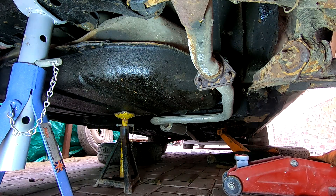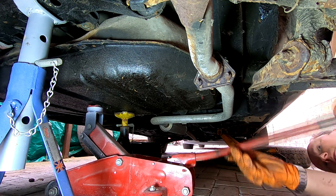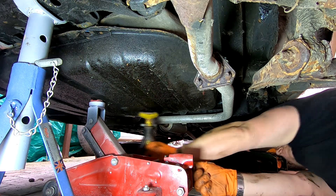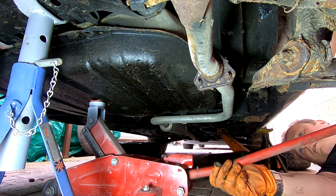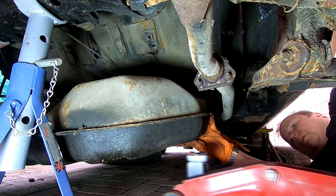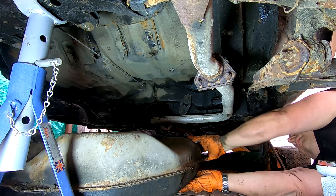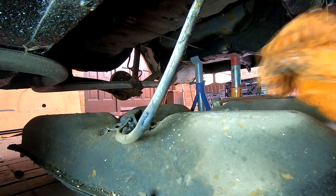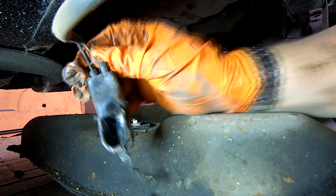Lucky enough I've got more than one trolley jack. I'll take that axle stand out and hopefully lower it down. I can't see the sender cable yet — there we go, ah that's better. Now it all looks clear. I can see the sender cable now on the other side. There's only one connector there — I'll just pull those connectors off. And that's it basically — I can now hopefully take the tank out.